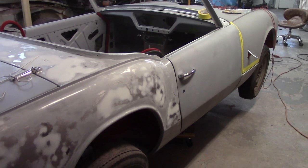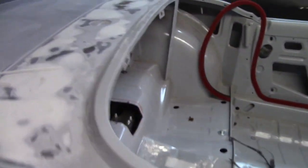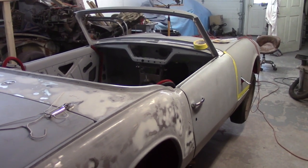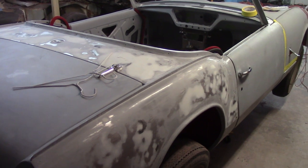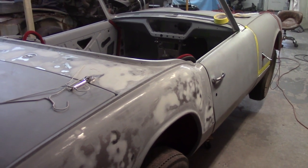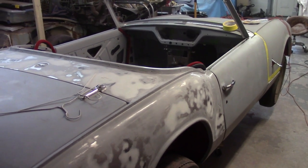I know I told you guys I wouldn't talk about gaps anymore, but what I'm kind of hoping is that it's a body twist or something that's opening one gap up and closing another. I'm hoping to remove or replace shims, including the spacers in the car, to try to twist the body a little bit to get my gaps right. I'll try to get the frame as level as I can, then look at the body and see if loosening and tightening can get any joy on getting this body lined up better. It's a bit of a shot in the dark.